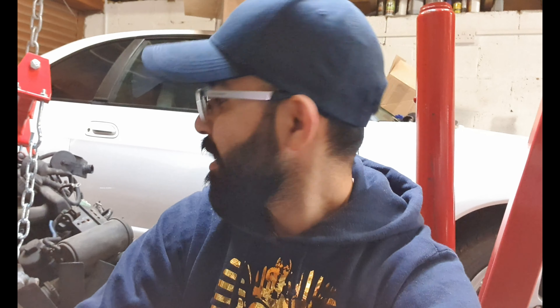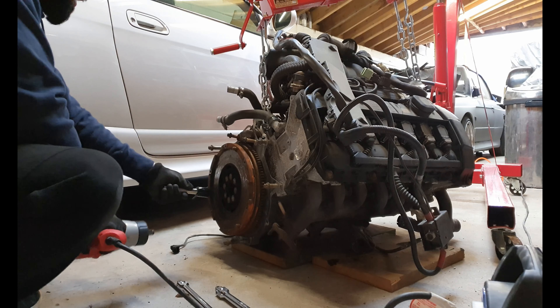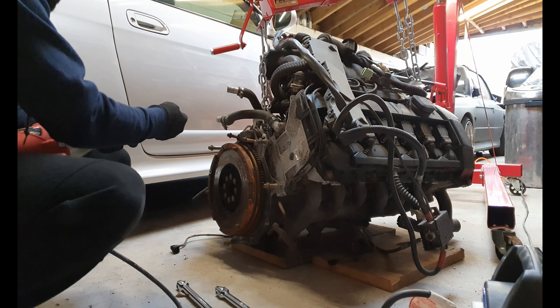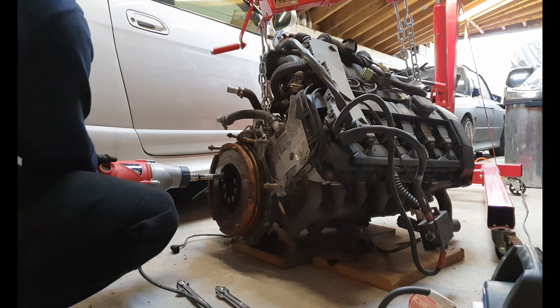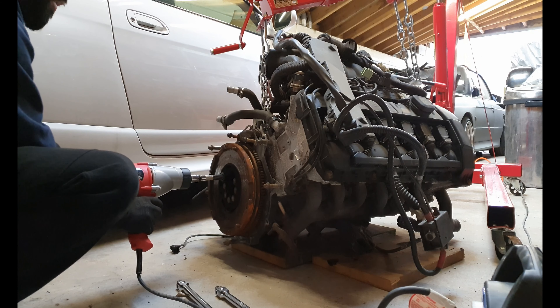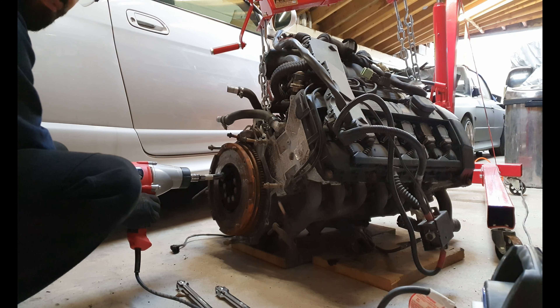It's an interesting day — I'm gonna be doing my documentary on how to do the engine swap. I want to jump between doing the vlog for you guys as well as prepping for that future video. Let's remove the flywheel. I'm looking at removing the flywheel, which is held on by 19mm bolts. This is a big electric impact wrench — my brother actually got it to remove the subframe from his R33. Hopefully it'll be powerful enough to loosen this up.